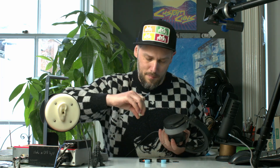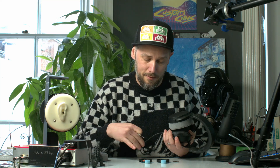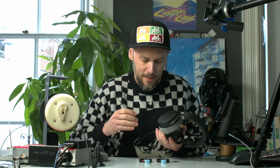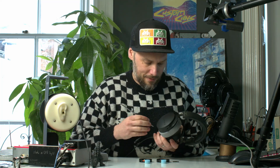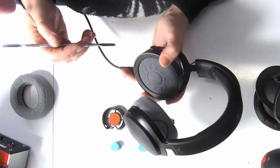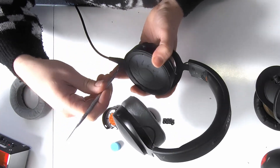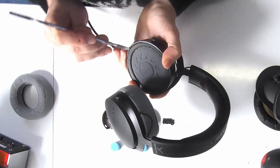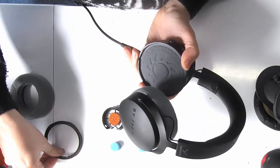Let's fit this mod and I'll go through some of the things I found while modding it. A lot of the prototypes were just getting it to fit properly. I did use plasticine quite a lot to figure out the shape of stuff, because 3D printing might take 20 minutes to print one of these, whereas I can squish a bit of plasticine in a couple of minutes and stick it back in. So if you're modding and thinking about 3D printing stuff, plasticine is still a very valid method for messing around with ideas.